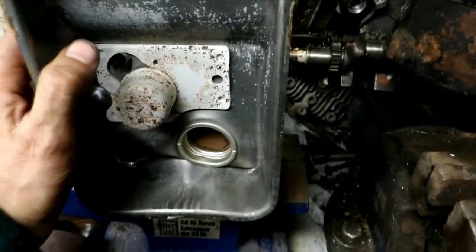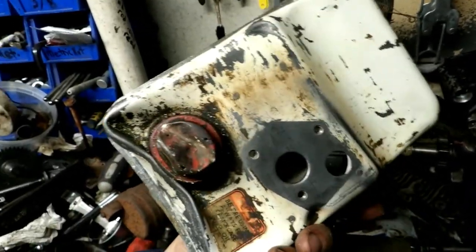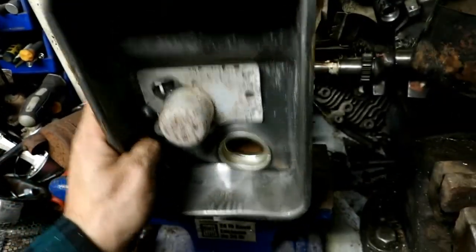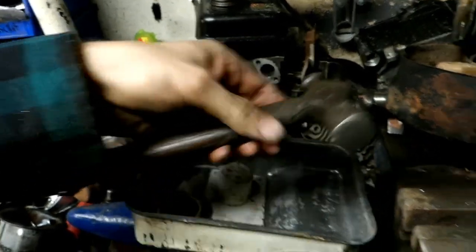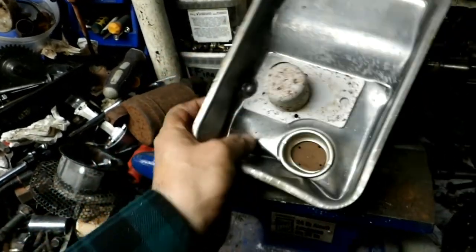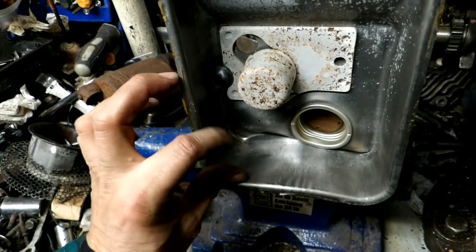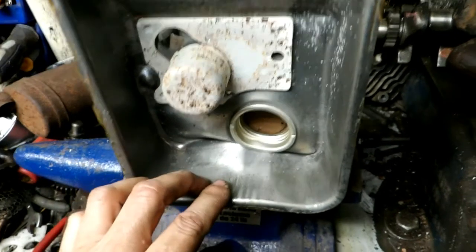So when you encounter something as damaged as this, you have to kind of plan out what the best way is to do this. I already pounded the dent on that end out, but that was easy. I just put it over the anvil like that and started pounding it with my favorite implement, which is this, about an 8-inch handle on a small ball peen. I think the handle broke, so I just chopped it off. Yeah, so this one, you've got to unstretch the metal backwards compared to how it was stretched. So I'm going to start just pounding down here on it. We'll see what that gets us.